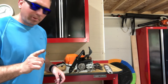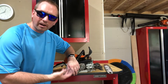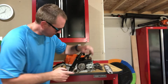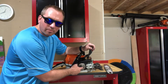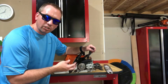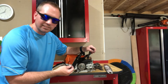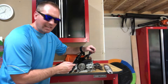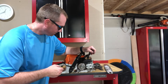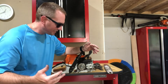However, there is one more lingering problem. When I took it off the shelf to get that last stump, I noticed there was bar oil underneath the saw. I believe the pump for that bar oil has an issue. I've had this happen once before — if a lot of dirt gets in around that pump, it tends to leak from that area. I'm going to have to take this apart, clean out that pump, and that should solve my problem.